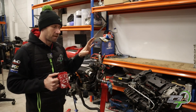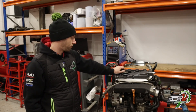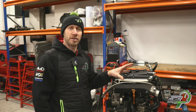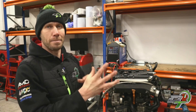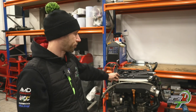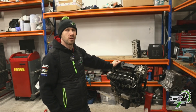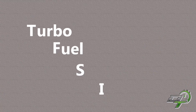That's pretty much where the similarity ends, because it's up top — the cylinder head and the fuel injection system — where it all changes. Before the TFSI came around, the 1.8T was VAG's petrol four-cylinder engine of choice. It features manifold port injection, where injectors are mounted directly onto the inlet manifold and spray onto the back of the inlet valves. This type of fueling is called homogenous fueling, where the fuel and air mix completely and are then drawn into the cylinder and combusted.